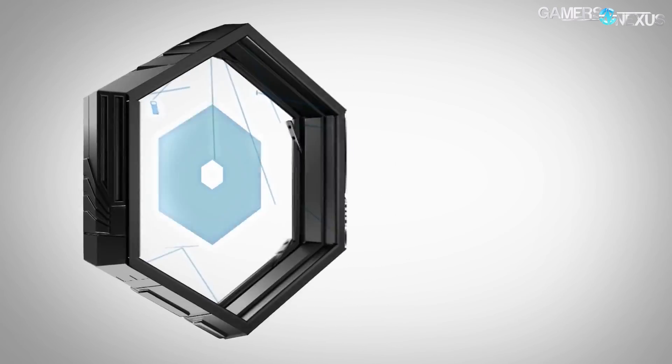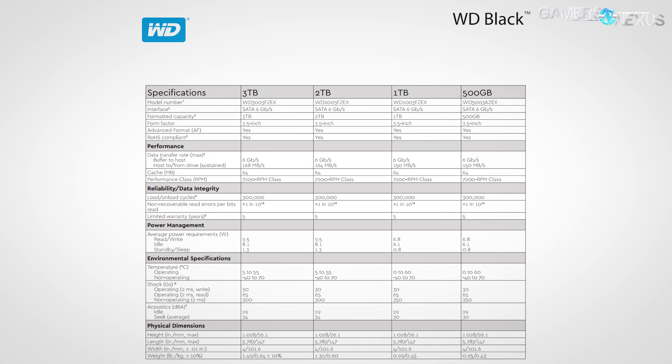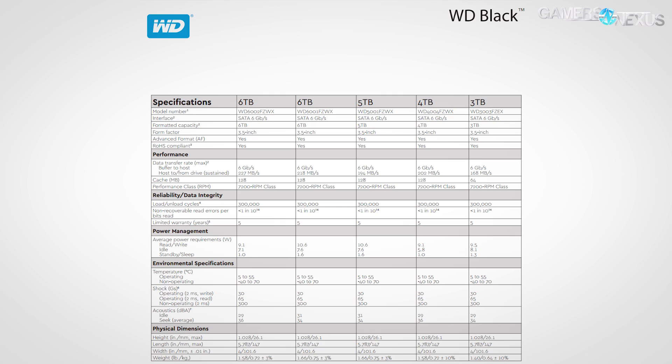Getting into WD Black, the five-year warranty is the biggest, most noticeable difference. They're all 7200 RPM from 500GB up to 6TB. The 6TB model, the flagship of WD Black drives, has five platters at 1.2TB each, totaling 6TB. The Black drive also has 10 total read or write heads, maximizing data density per platter and minimizing head travel. The previous WD Black 4TB drive had half the DRAM cache as the current 128MB build, with cache provided by Nanya, accompanied by a dual-core controller from LSI. WD Black focuses less on noise than WD Blue, but does include vibration protection features alongside that five-year warranty.